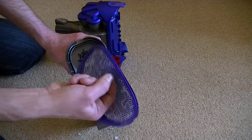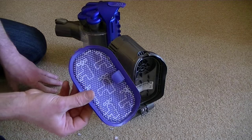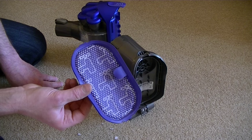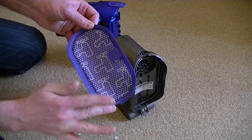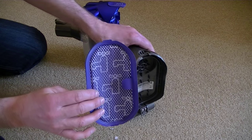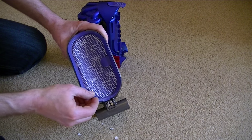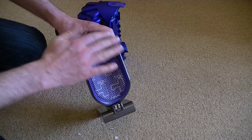There's a little tab there, so you just pull that off, rinse it, squeeze it, and leave it somewhere to dry — not over a direct heat, just somewhere warm. If, like me, you have another vacuum cleaner, to save washing it frequently you can just use the suction nozzle of that cleaner to clean the filter. That means you're not washing it quite so often. But from time to time I would recommend giving it a more thorough wash. Once you've washed it, it just pops back in — make sure it's located all round and sealed.